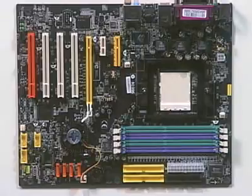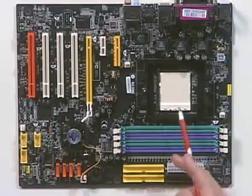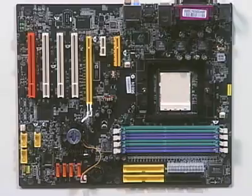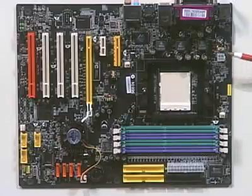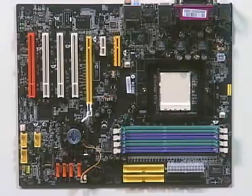So in addition to our disk drive connectors and our memory and our expansion slots and our USB and our CPU, we also have various types of other connectors that are used for a variety of different purposes. Now some late model motherboards, because of the CPU requirements, will have an additional power connector, and it's a square 4-prong connector that you can see right here. Not all do that though. Many will just use the power connector down here.